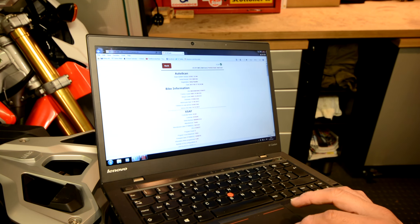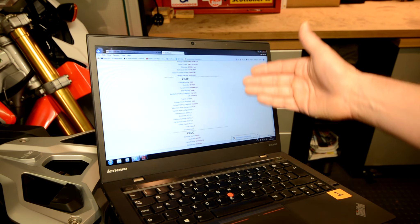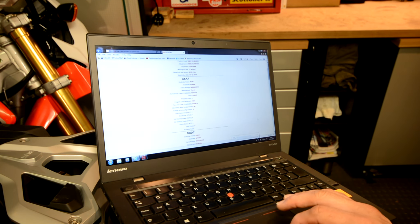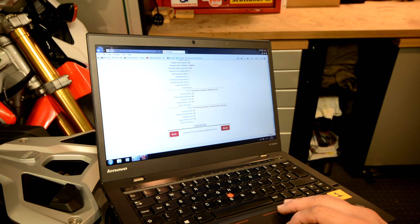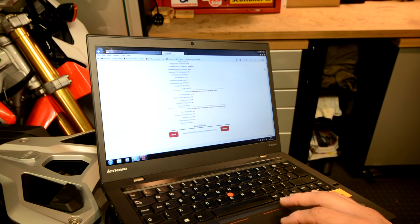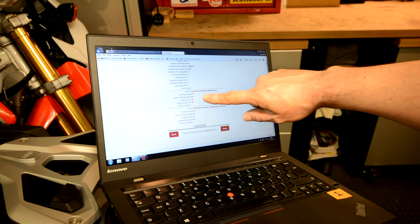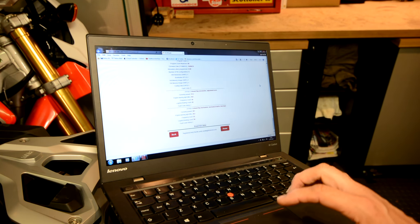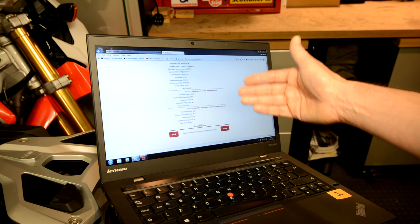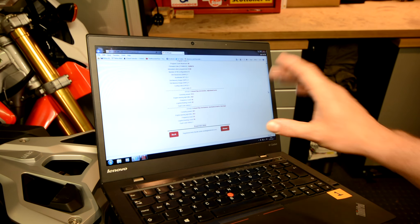It comes up — I won't go through all the detail with you — but you can see the sorts of things it's got in here. It tells you various serial numbers, manufacturers, dates, when various controllers are installed, all sorts of basic configuration information about your bike, all the ROM codes, manufacturers, everything. Basically it gives you everything that the bike is reporting, including any fault codes that come up. And here, look, we can see that I've actually got a fault showing on the exhaust flap servo motor — adjustment error. It's currently present, happened 48 times. So that's something when I next go to the dealers I'm going to talk to them about — the exhaust flap servo motor and get that adjusted.